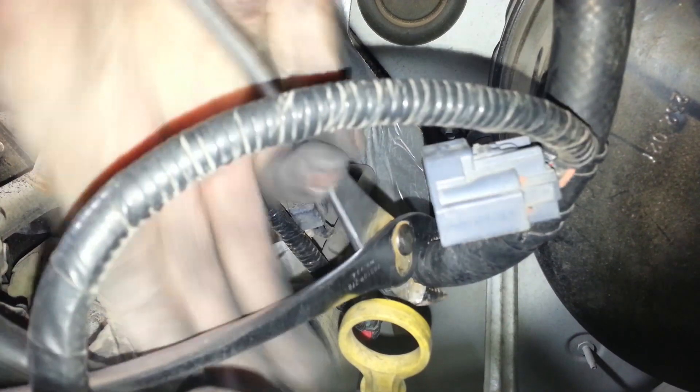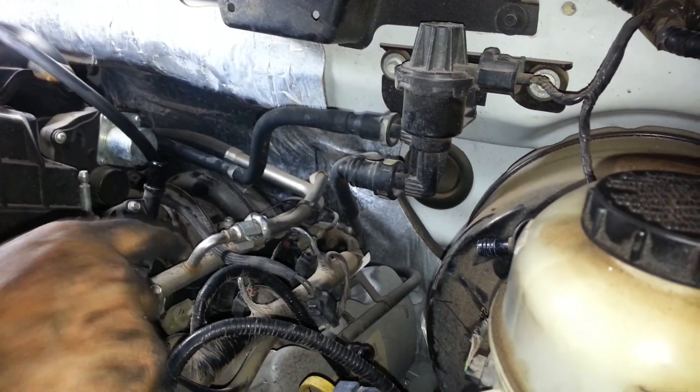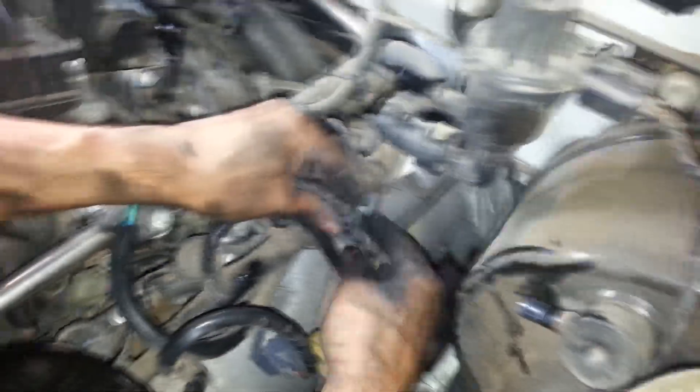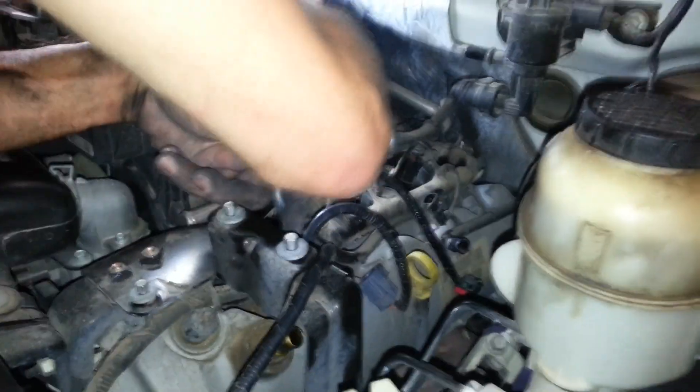Get your pliers, turn it to loosen it, and that will let you remove it easier — just pull it and disconnect it from here. Then stick your needle nose pliers here to disconnect the hose and move it over to the side. The next one is this other vacuum hose for your 4x4 — all you do is squeeze it and pull it and it disconnects. Pull it off to the side. The next one, all you do is squeeze it and it pulls apart. Remove that one out of the way, and the next one is this vacuum hose right here — pull it back and remove that.